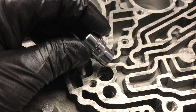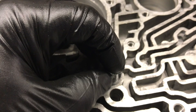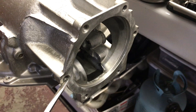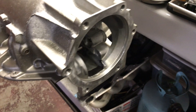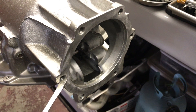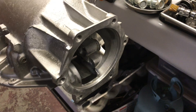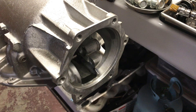The center support bolt is 3/8 12-point. Make sure your socket is small enough that you're not going to hurt the aluminum — a lot of sockets are pretty thick and it'll bell it right out. Before you attempt to remove the tail housing bolts, smack on each one with a small ball-peen hammer — that'll help break it loose and not pull the threads. If you just hit it with an impact gun you've got about a 50-50 chance if it's been run a while. Usually up at the top it's really dry; down below they're well lubed, so the upper ones are questionable and will probably pull the threads. Smack them first, then work back and forth with the impact and you'll save yourself having to helicoil it.